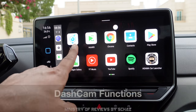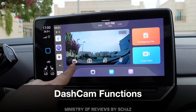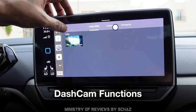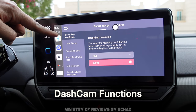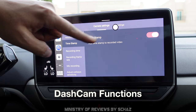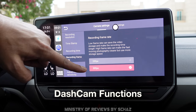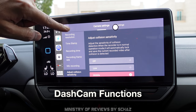To access the dashcam, go to the Lotkey app. This is the dashcam view — it's already recording, indicated by the red icon. You can take pictures, view loop-recorded videos, and check the live view. In settings, I've set the resolution to 1080p, added a timestamp, set the loop video file to 3 minutes, and the frame rate to the maximum 30 fps. There are also mic recording and collision sensitivity options.